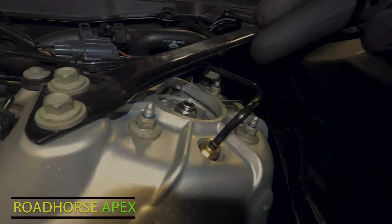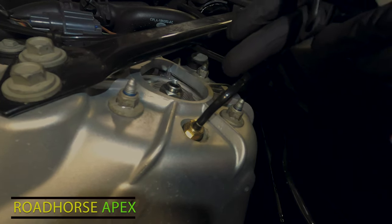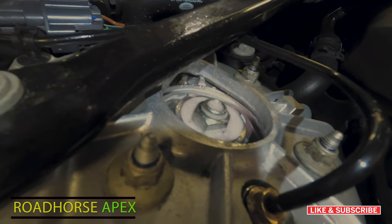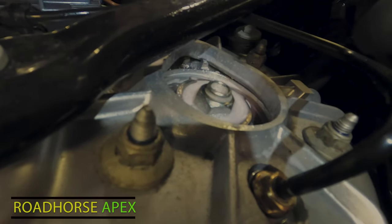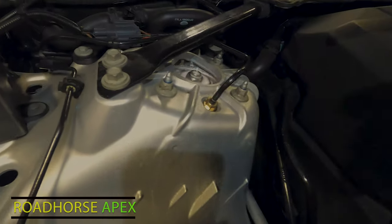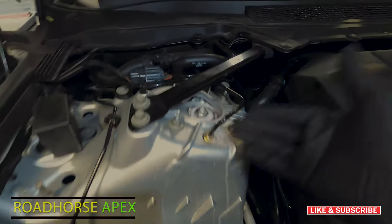So now we're gonna go ahead and repeat the test that we did earlier using the soap water. Because now we wanna see if we have indeed fixed the problem. We wanna see if this suspension is leaking like the one before. So let's go. See that? Here we go. Instant difference, guys. What we had before, the moment we started to spray the soap water in it, we could clearly see the air bubbles just blowing up. So that confirms that our repair is good. Another job. Well done. No leaks, no bubbles.